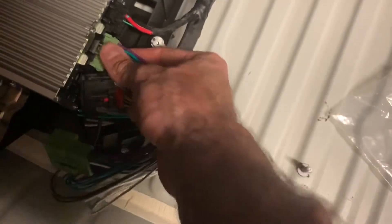The first one I had was real stiff on the mating connector to the amp, so I'm going to see how this one fits right now. Maybe it'll be a win-win because this guy went in super easy, just like a factory connector. So just like the previous harness, this big one's still a lot of effort to get in. I'm not going to fully seat it because I'm going to solder my line level adapter into here. So I'm just going to leave this resting here so it doesn't bang up against anything, and we're going to go ahead and solder up our harnesses.